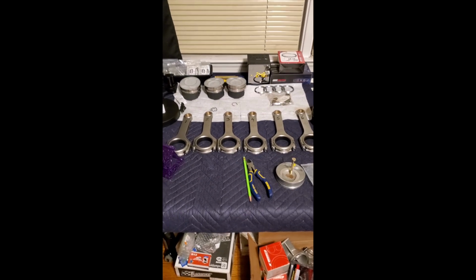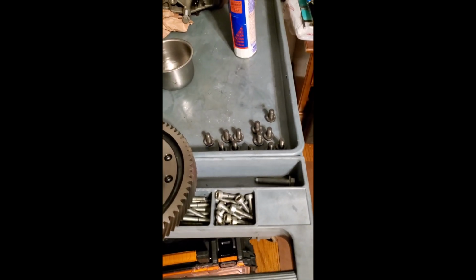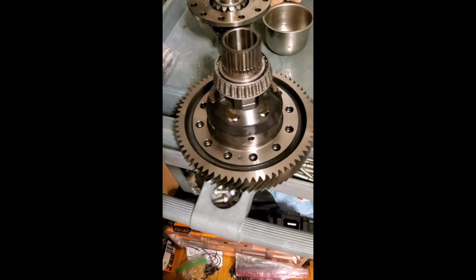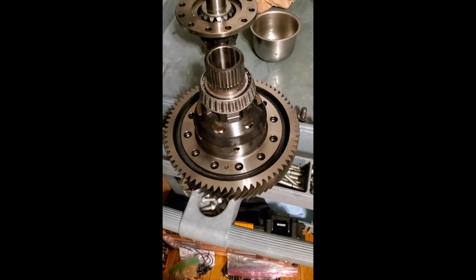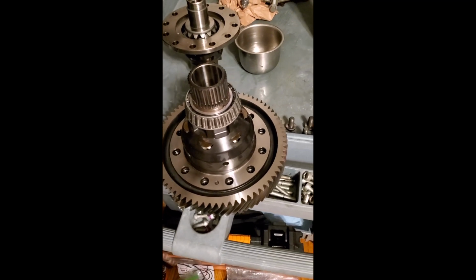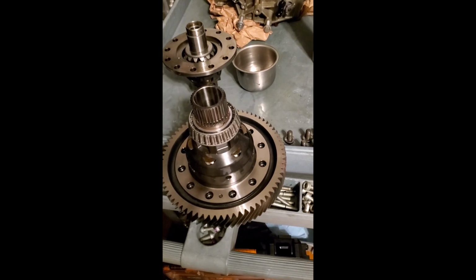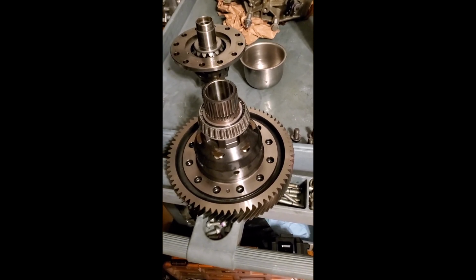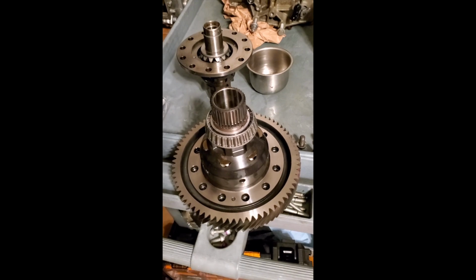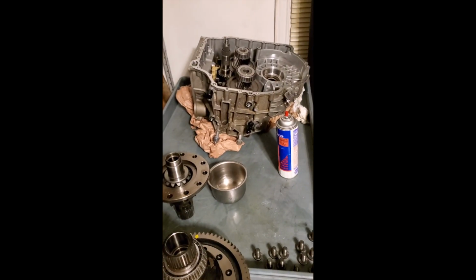2:48 a.m. before I go to work today. I have all of the bolts taken back out of the diff, cleaned all the bolts up with carb cleaner, as well as cleaned the bolt holes up. So today I'll put some Loctite on each one of the bolts and torque it down to spec. I also ordered a seal kit for the transmission, so that way once I get everything back up, if I need some extra seals, I'll have them ready and available to install them inside the case. And today, after I get this torqued up, I'll put this back into the transmission case.